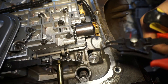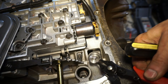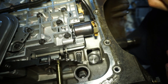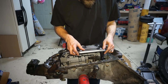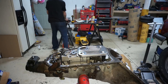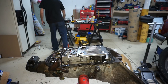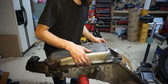Okay so we're going to try this again — got a different end on it, the one that comes down at a 45-degree angle. Give it a swirl — there we go, a little bit better. That's in there and it should be done. Next I'm going to put the filter back on, and then we'll put the pan back on with the pan gasket first, then the pan. And this should be the last little bit of this rebuild that I should have to do with this transmission.